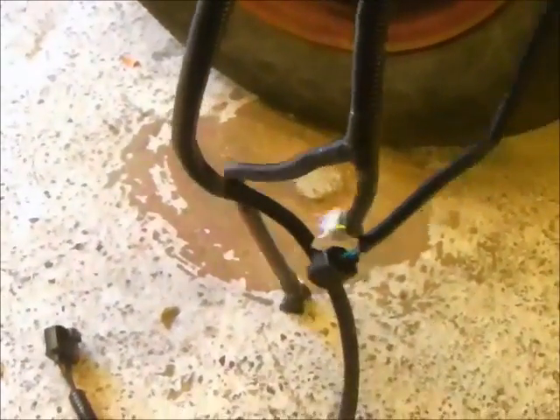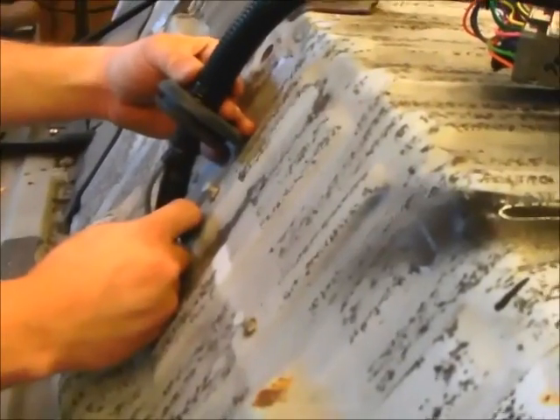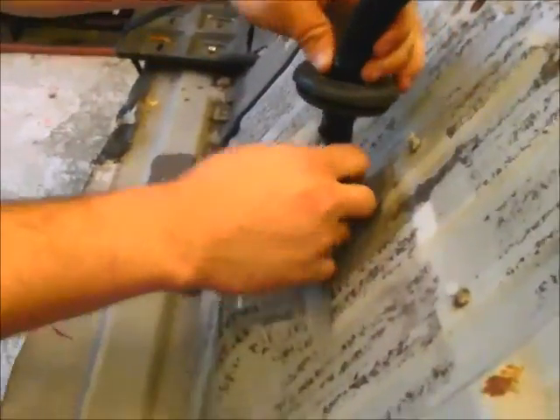You can see the wires out here in the wheel well — there's the coil wire, one of those plastic clips, the speed sensor wire, the O2, and the mass air meter. At some point you need to get under the van and make sure you're routing these to the right side. For us it's a little easier because it's not a complete van, but basically it's a matter of routing them through that hole and making sure they end up behind the spring perch. Now Nate's got all the wires through the hole, and the last part to go through is the actual grommet, which will seal off the hole in the body.